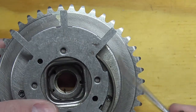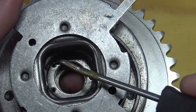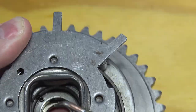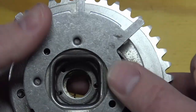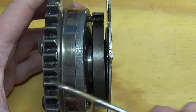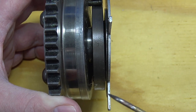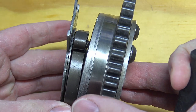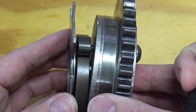On the inside, you can see there are three roll pins, and you can see how loose this one is — they're very loose and can also be missing entirely. These hold the reluctor ring on properly. This reluctor ring should sit flat and sucked in. Right now you can see the top part is sticking way out while down below it's recessed in. That cocked position will cause issues with your cam sensors not being able to read properly.